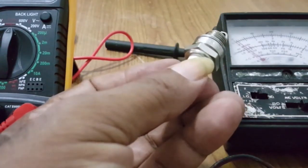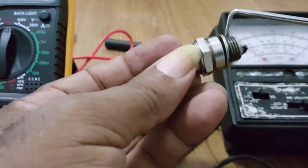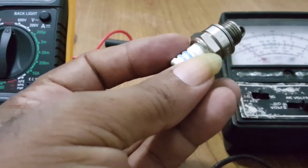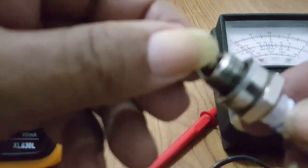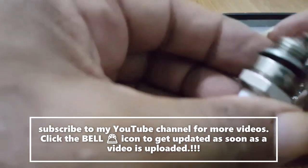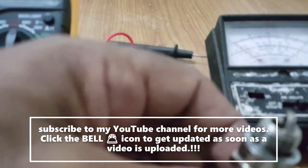Your spark must be blue. Once you have a good blue spark, that means your spark plug is good, your coil is good, and your lead is good. Check the description for any other things to check. I'm trying to reach a thousand subscribers — if you like this video, please support me by subscribing. Until the next one, bye bye.